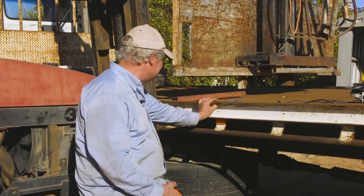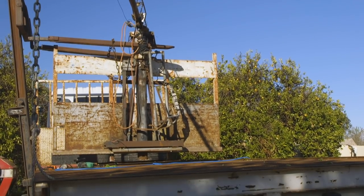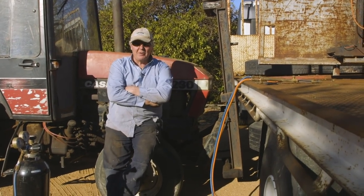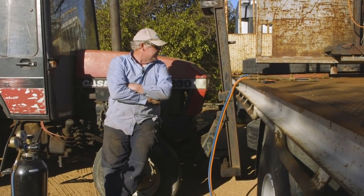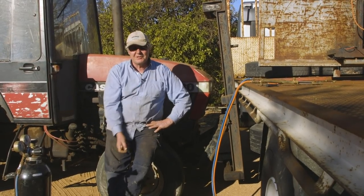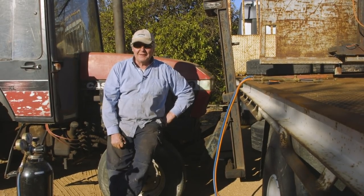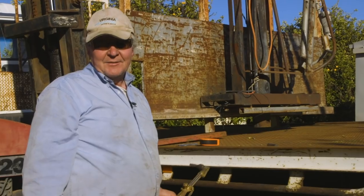Then it might look like it belongs, because that little truck was narrow in this one. There's always some fun when you're retrofitting stuff, isn't there? So we thought the most easiest way to blow a hole in the deck of the truck here is to get our oxytorch out - all that does is pretty much heat the metal up, and then when it gets hot enough, you blast a bit of oxygen to it, and then it just atomizes the metal, and you can cut holes through it. A lot quicker than drilling it. If you bucket it up, you just weld the hole back in anyway and just pretend you weren't here.